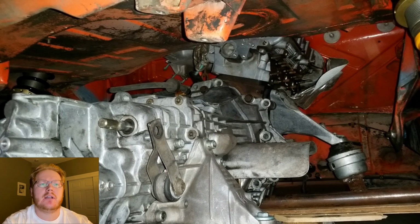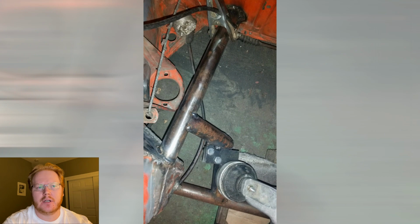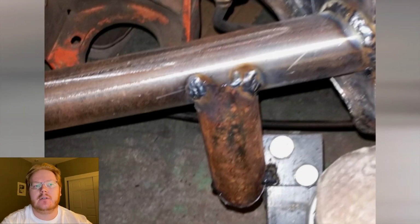After finalizing the mounting location of the engine and double checking to make sure that I had the transmission perfectly centered between the trailing arms, I tied into the trailing arm bar that I had mentioned earlier and mounted to the 1/4-inch plate that I had previously mentioned. Now, the pictures might look like a hack job of steel holding everything in place, and well, good, because that's exactly what it is. But it works, and the crossbar doubles as a chassis brace.